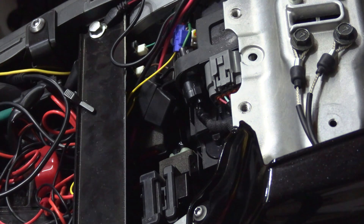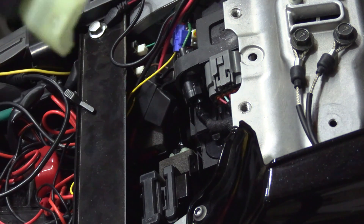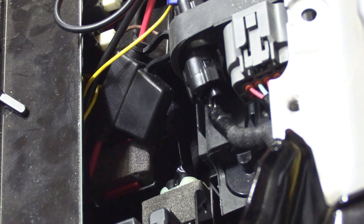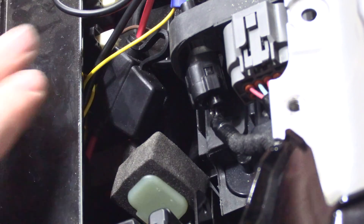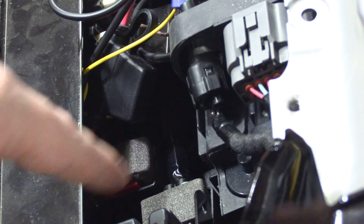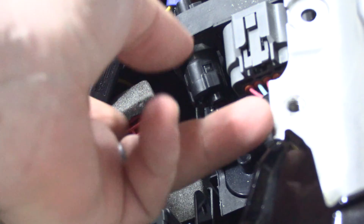I believe in 2020 they switched to the red Euro style cables rather than the old cables that Kawasaki used. So depending on what year motorcycle you have, that will determine what adapter you need to get. 2019 and prior have these connectors — they have two of them. You do not want the rear one; you want the more forward one. You'll know if you got the wrong one because you'll plug in your code reader and it won't read anything. On 2019 and prior it'll look identical to this white cable, but on 2020 and newer ones it's got these red Euro style cables.